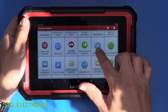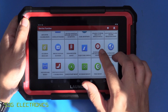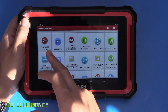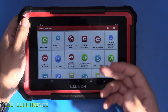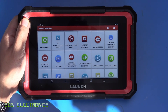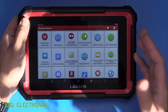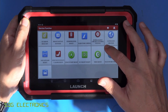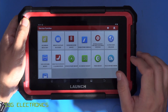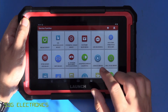We've got all of these resets and learning functions for various modules in the car - the types of things you'd normally have to pay for - included with that two-year license. There's things like relearning the gearbox and all the clutch positions, resetting the TPMS system, DPF regeneration functions like forcing a regen or associated resets, putting the brakes into parking mode, steering angle reset, resetting adaptive front lighting, and injector coding. So if you replace the injectors, you can put in the coding value so that it injects the right amount of fuel. Lots and lots of stuff, really valuable if you use this professionally.